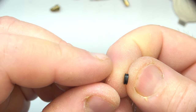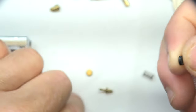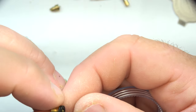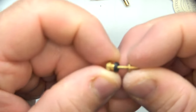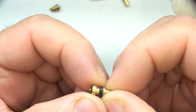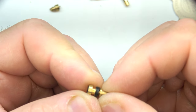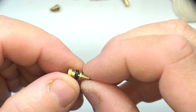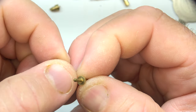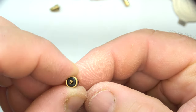What I've been using is these seals to rebuild them with — the same ones I use for rebuilding the internal gas valve. These work great, but the problem is they're wider than the original one that's on there. What that does is it doesn't allow your pin to protrude up as much as it normally would. So when you go to fill this up, you can't push that pin down far enough to get any butane in there. The butane actually goes around this pin.